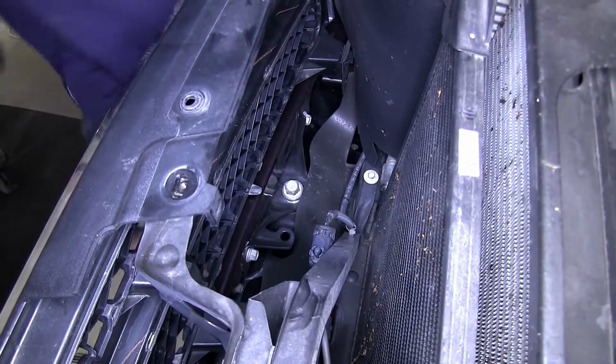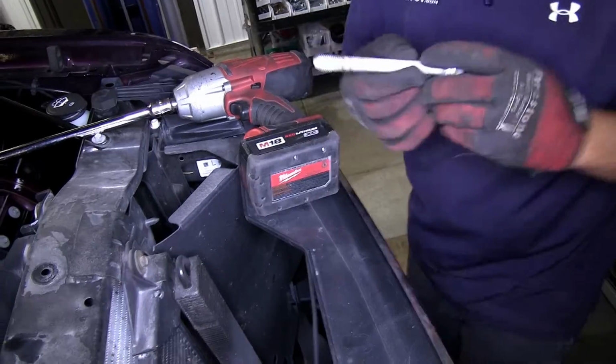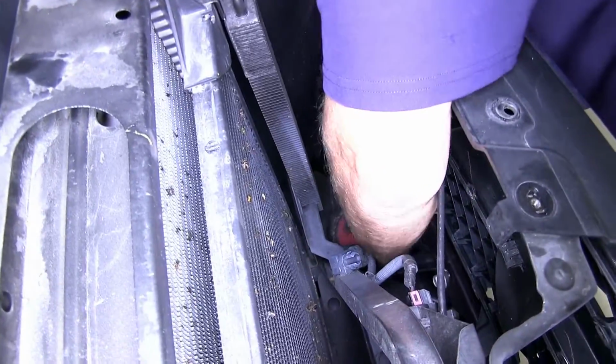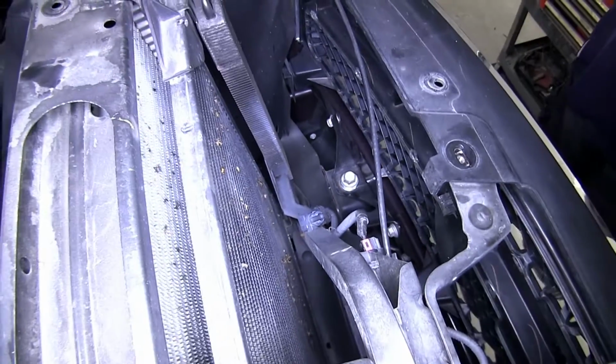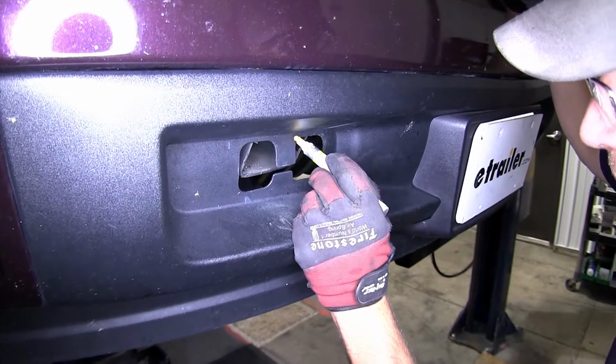On the driver's side, however, we'll need to install a 5th washer, as the threads still protrude below the weld nut in the frame too far and make contact with the base plate. Now with both bolts reinstalled and secured, we'll move back to the front of the vehicle.